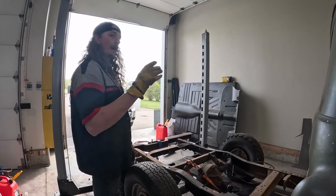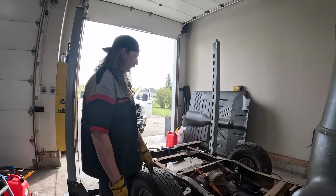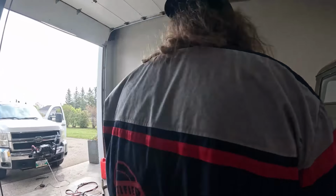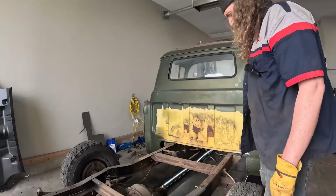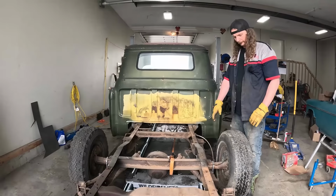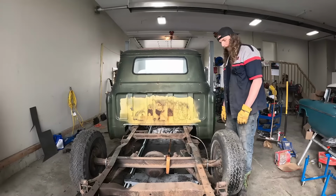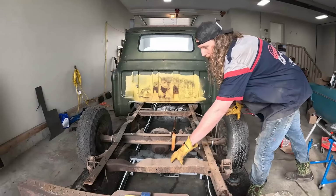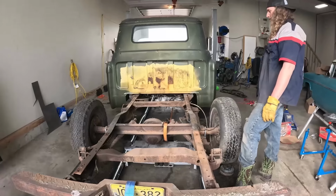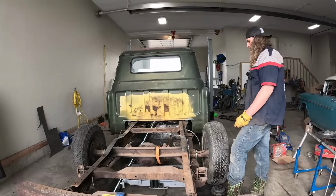Put that on there. We have that 12 bolt of the Nova, which I believe is the exact same width as this. I'm pretty darn close. So we'll put that in there, and it'll obviously, well, I don't know how much it'll eliminate. This thing has a lot of room between the leaf spring and the tire, but we should be able to put a pretty meaty tire on this thing just for kind of a good look. And then while we're at it, I might straighten out this little bit of the frame section there, and yeah, kind of see what we end up with. But it should be kind of pretty quick. I've already C-notched this thing, so that's cool.